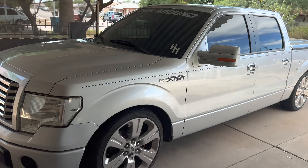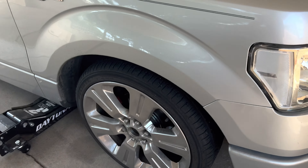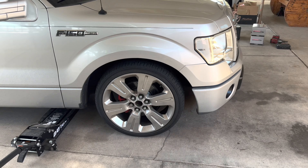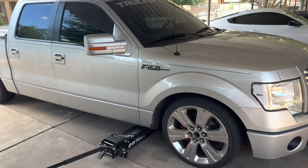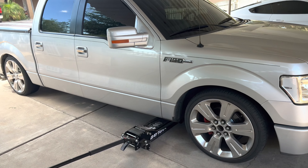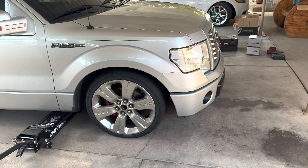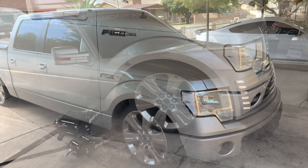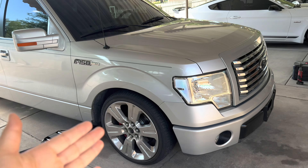With my truck, I did the color match and low-pro tires, and that's pretty much it. The only thing now is that my hub bearings are starting to grind on the passenger side. Don't mind the missing wheel cap — I think it just flew off. It started to grind, and while it doesn't have any play in it, you can hear it grinding when you go about 75 on the freeway. At lower speeds you can kind of hear it too.